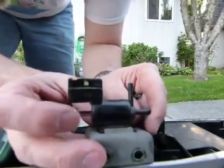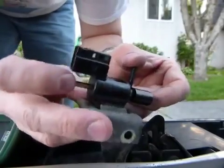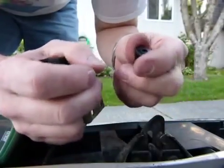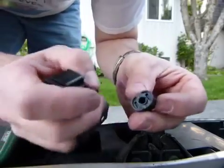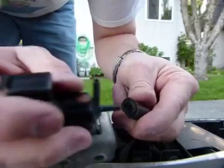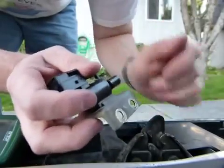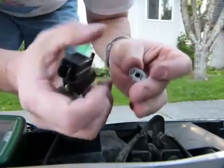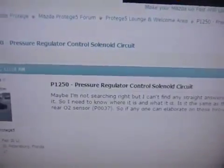This would be port A - from which I just took off the square unit - port A, port B, and port C. I'm gonna check it with a hand vacuum pump. It sucks in air through the square openings - that's the intake - and it transfers it to the round side. The engine is sucking air through both of these, and there should be airflow between these three ports in a special pattern.